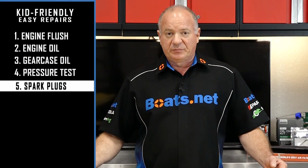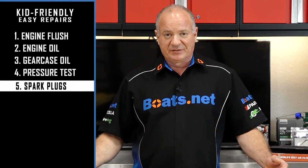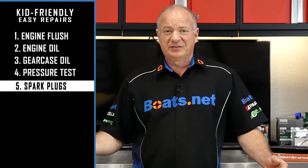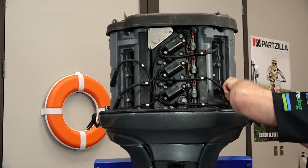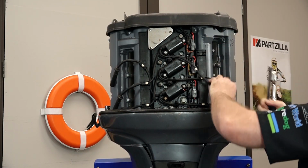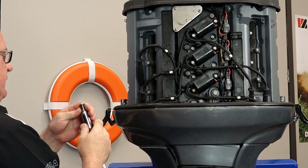Next, let's take a look at those spark plugs. That's going to give you a really good picture of what's going on the inside of that engine. Sometimes it's overlooked, but it is really simple to do. You just pull them out, take a look at them, make sure that electrode isn't worn too much, and then either replace it or put that old one right back in there.